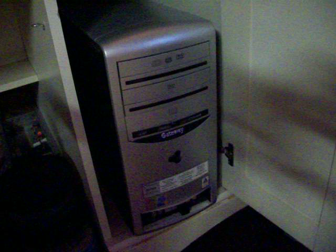Okay, we're back at the computer. I picked up my part. This is the one that I took out — it was something I had gotten off of eBay for a real good deal, so it got us by for about a year and a half, but it failed. It's a 400 watt, 115 volt or 230 volt. There was no model number on this. Fortunately I had saved my original, and my original said it was a Bestec with the model number ATX300-12EB3.